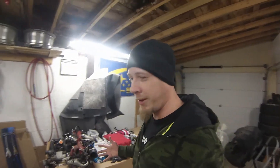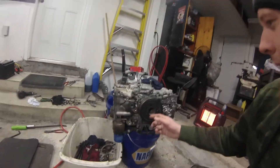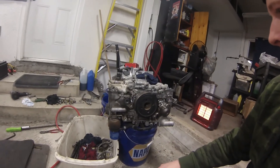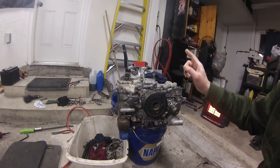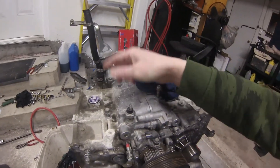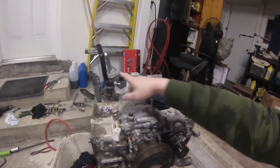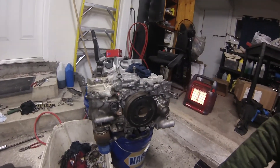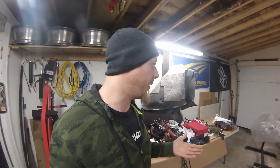Anyway, time to move on. We've got a block to do here. What I want to get done is the oil pump swapped over, the water pump, and the oil cooler. So I'll probably have to lift this thing back up, put that AC alternator bracket back on for like the third time, break this clamp down here, and get the hose over — I'll probably have to get a normal style gear clamp. And then once that stuff's on, I'd like to move on to working with the head studs, because this new block is actually drilled for the half-inch ARP head studs, which are larger.